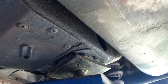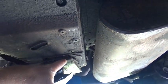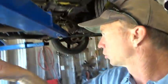It's just a little bit of extra stiffening they did because they knew the top was weak. I'm probably going to have to take my side grinder, mark a line, and go straight down on the subframe piece. I may have to move my jack, lower the car, and move back. When I jacked the car up, I made sure all four points lifted the whole car at once, because you don't want your anchor points forward or backward. You can't jack a convertible from one end and weld, because you're actually twisting your frame. Make sure the whole car picks up at the exact same time.